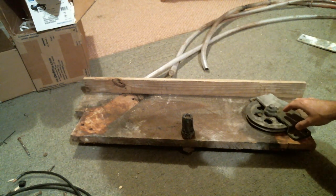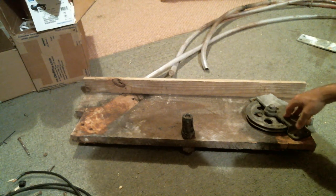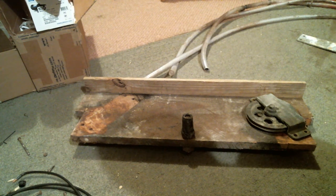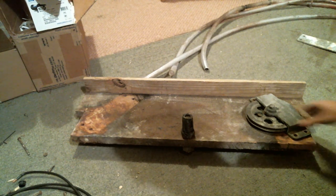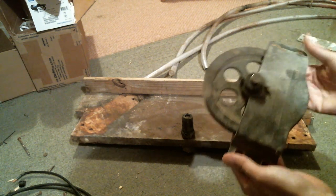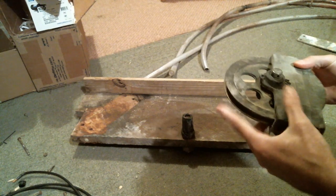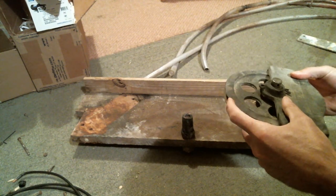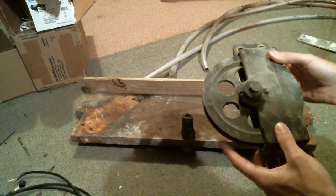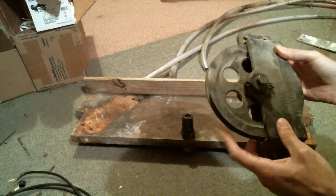And then with the pulley, like with most of the hardware, I've been giving it a bath in some diesel, letting it sit there for a day or two, and then bringing it out and brushing it clean. That's been working pretty well for me with the other hardware. So you get a good look at this before and see it afterwards. Hopefully it's looking a lot better. It moves, but not very well. It's definitely old. And then get it oiled back up, and it should be good to go.